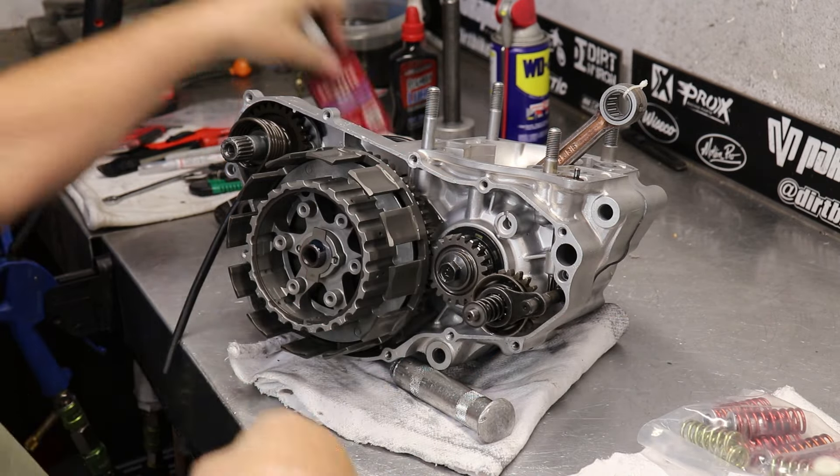Motion Pro has some really cool tools that Brad uses a bunch, and it's really helpful when you go and assemble these engines to have nice tools like that. Air gun is nice — we call them ooga-chuga. Brad can bend that washer around. He uses a wood block to work on, and he even props up the engine in different places. These sleeves are custom to Recluse — they protect the basket. The clutch plates will ride against those sleeves, and you put your plates back in the order that they tell you. Recluse has really good instructions with all the different thicknesses and what order to put the plates, so you really want to follow those as you're putting it together.